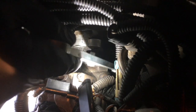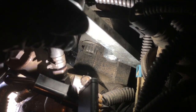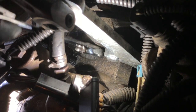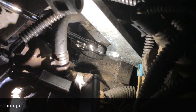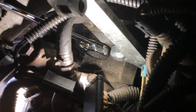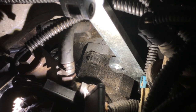We've got both lower nuts loosened. Now we're going to come up here and put the turning tool into the two alignment holes, put the breaker bar up in the top — there's a three-eighths inch hole there — and just use a regular 15mm ratcheting wrench for the camera work. I need to get into a position where I can see the scribe marks we made.